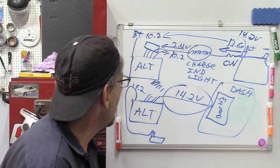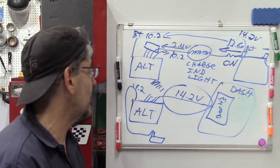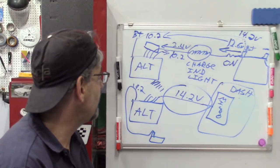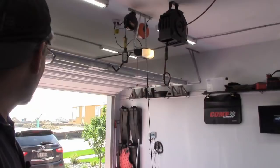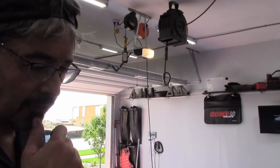It would be charging the battery and you would be fine. It's just that the sensing system doesn't see it. That's what I'm expecting if they are correct at that automotive shop on the alternator and battery being fine — it's going to be some problem with this wire. I will either pull up a wiring diagram or just hunt for that wire using a DVOM myself. But let's get this car in here and take a look. It's like a complication, guys. I actually want to pull the car into the garage and the light is not on. The owner said it actually hasn't been on all day. I didn't realize this was an intermittent problem. So that adds a new level of challenge — we're going to maybe take the car around for a ride, see if we can get that charging light to come on, and bring a DVOM with us to do some checks.